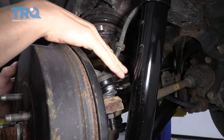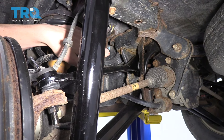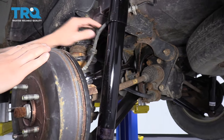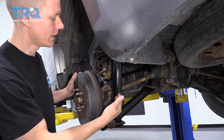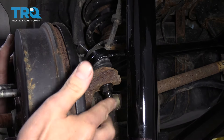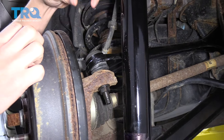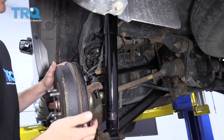Up here we have a rear upper control arm. In this case there's a ball joint on the outer end and a rubber bushing on the inner end. Where the rubber bushing side is, there's usually a pretty big bolt that's quite tight, so you'll need a breaker bar or an impact gun to remove it — spraying some rust penetrant on it is usually helpful. On the ball joint end, sometimes there's a castle nut with a cotter pin and sometimes it's just a bolt tightened to a certain torque. To remove them, you can use a pickle fork — it goes in between and you hit it with a hammer — or you can use ball joint separators. Sometimes a hammer works just fine as well.